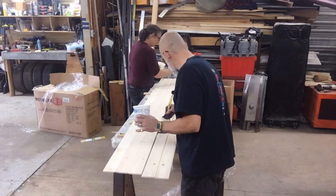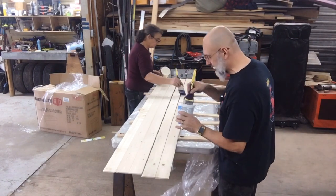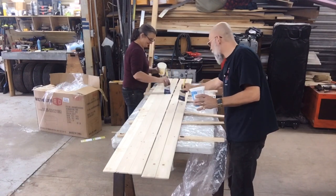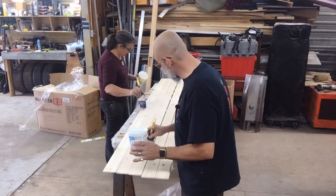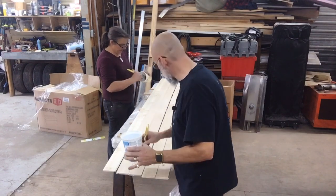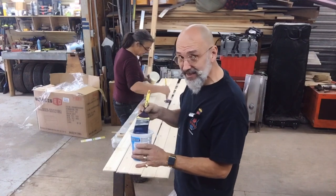That being said, the bus can take almost as much weight as we can throw at it. But the lighter it is, and the lighter the materials at the top, so we want the weight near the bottom and the least weight near the top, the better handling and safer the bus will be as well.